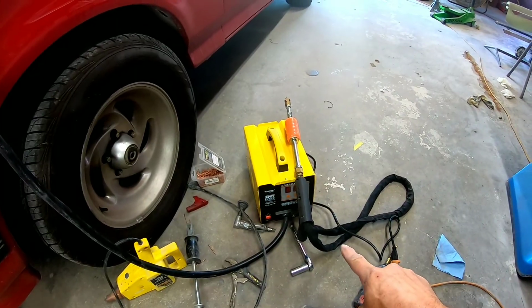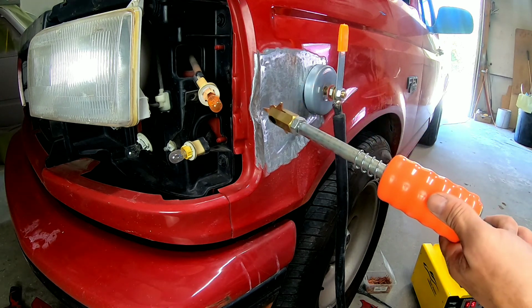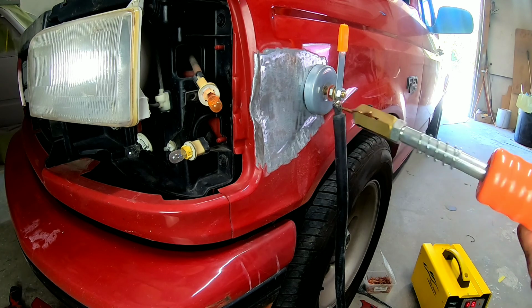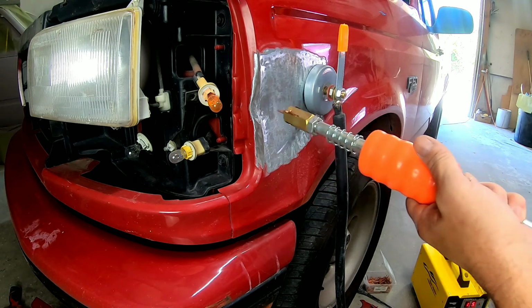I'm gonna try the G90 dent puller on this dent. The stud welder is not working very well. A copper tip here that you weld on, and then you have a slide hammer that you slide hammer the dent out. If you haven't seen the video for this, check it out. It'll be in the description or a link at the end of this video.